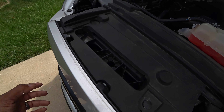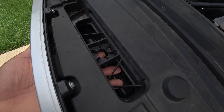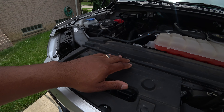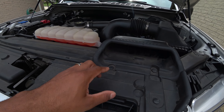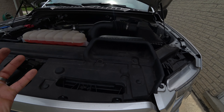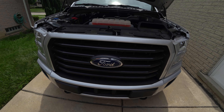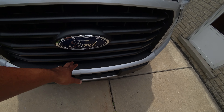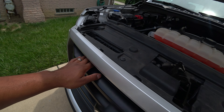All your air goes through the grille and then it has a way to get up into this little chamber. It's interesting because it's actually blocked off — there's a little air dam built up around here to divert the air into this opening. It cools your radiator, your trans cooler, and your intercoolers under here too, but it diverts a lot of air back up.